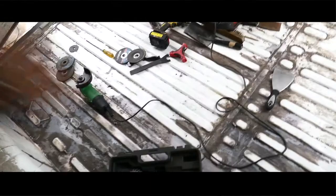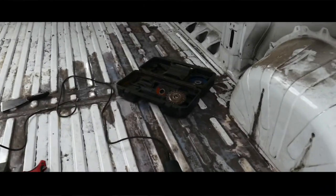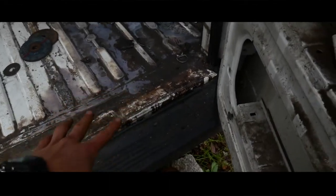Now basically red oxide. First I've got to sweep all this, and the reason I've started this video is because it's going to be rust treatment. I'm sure you've all probably seen these before on van builds because it's quite a common thing to have rust. So I'm going to get a wire wheel because they're great for getting back rust - these things are amazing. And I'm going to grind back this step pretty much completely because the doors overlap over it and the insulation can't come that far.